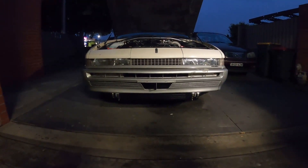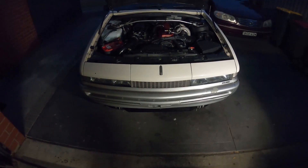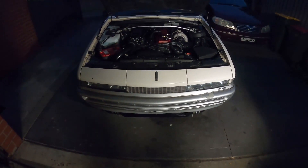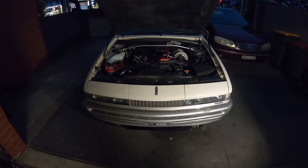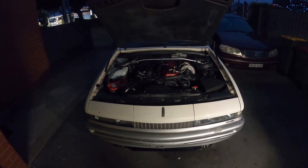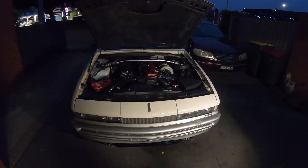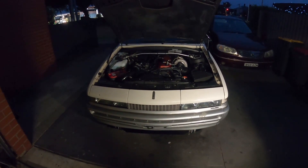Got it all back together — looks good. The cooler sits down as low as the old one did, so pretty happy with that. Everything's together and the car's running. It's pretty dark outside now so I won't be able to do a proper driving video tonight — when it's daylight I'll take it for a drive and let you guys know my first impressions. The car isn't tuned yet to suit the new manifold — I need to upgrade the fuel pump and put bigger injectors in, turn the boost up and see what she does. For now she should be drivable. I'm not going to boost it too hard until it's fully tuned. See you next time!